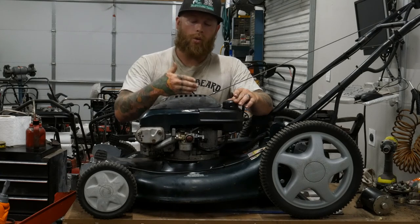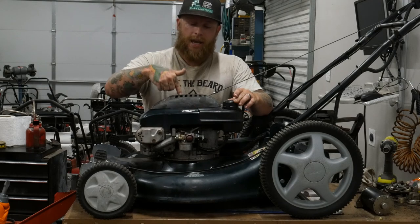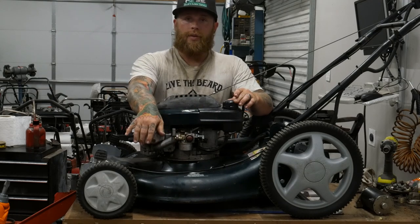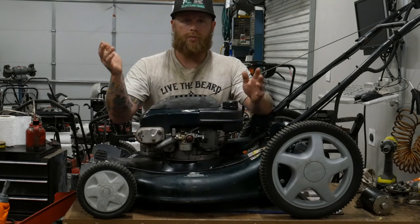The reason being you don't want the oil to spill through your case into your carburetor because then you're gonna have to change that. And actually on these Tecumseh models, the muffler is over here too, so that will also get full of oil. And then when you start it up, it'll smoke like a chimney.